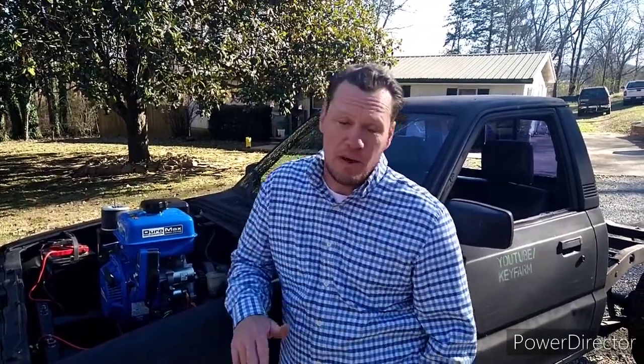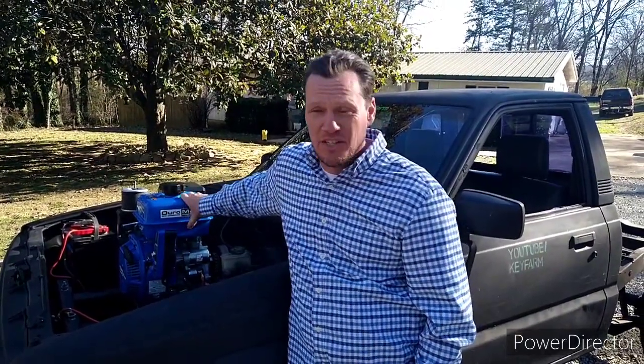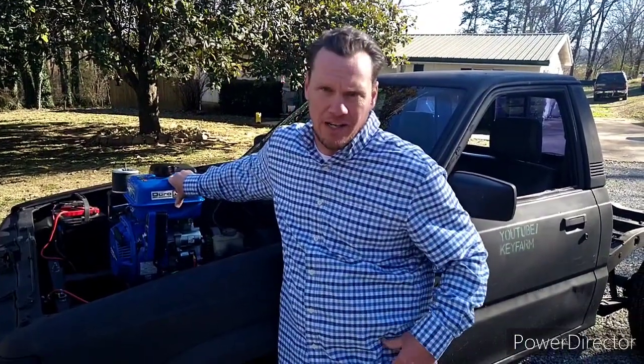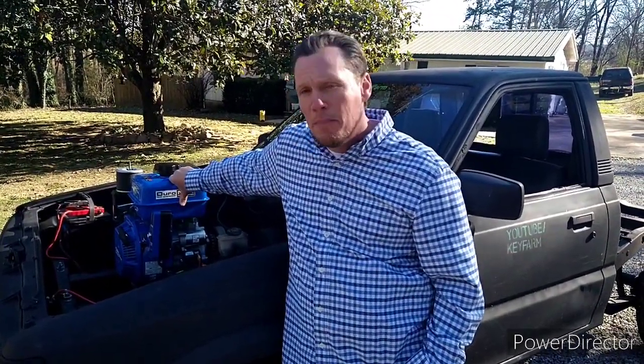The truck is not doing the 50 miles an hour that I had hoped for, and it's just about governing out in overdrive. I'm afraid if I put a smaller sprocket on the bottom, we're going to lose a lot of bottom-end power even if we gained a little on the top side. I don't really want to do that. The new clutch is holding up great — it took a lot of the chatter out and made it a smoother takeoff between gears. Everything I've read says it's not a true 18 horsepower engine. People that know more about small engines say it's probably between 13½ and 14½, and that would explain why we're not getting 50 miles an hour — we're running out of power before we're running out of gearing. It does have good speed and power in first gear, so I kind of don't want to monkey with the gearing anymore.